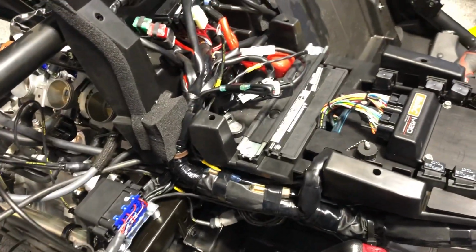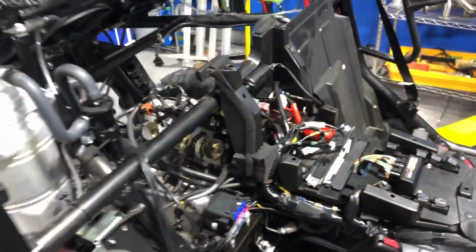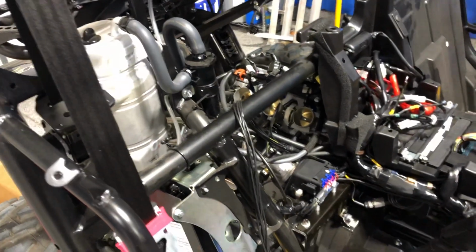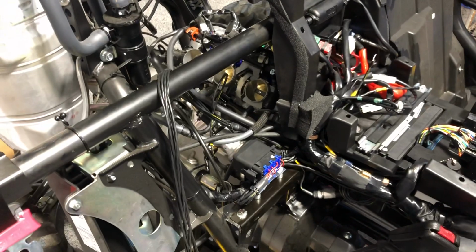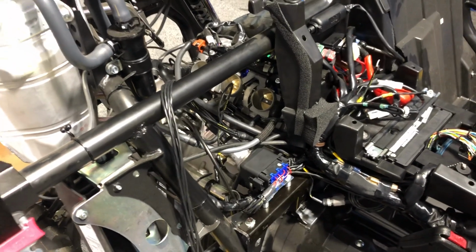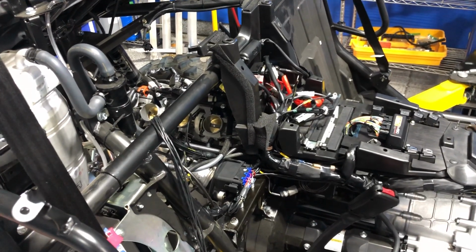Now, onto the custom. I added a bunch of stuff to this because we're using this car to prototype some parts, and want to be able to see where we're getting improvements and if we need to change or rework any of this stuff once it gets done. I should say also, some of those additions are for safety when we try to go for big power on this setup. Safety options: added a knock sensor, it's got an oil pressure sensor, it's got a fuel pressure sensor, and we're running a wideband,